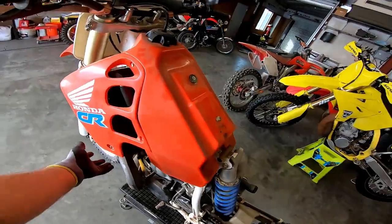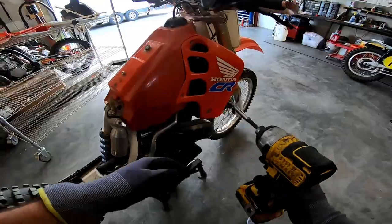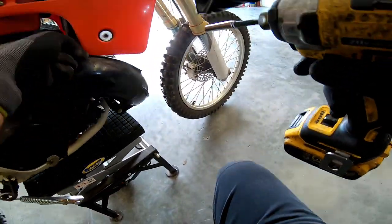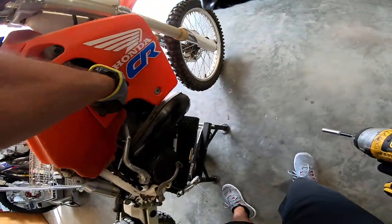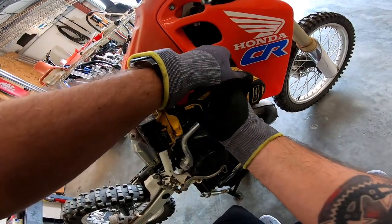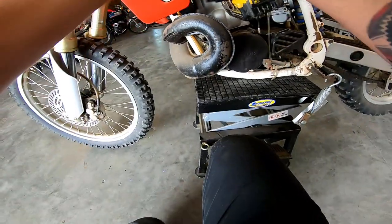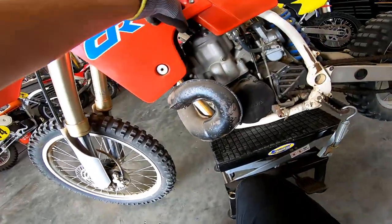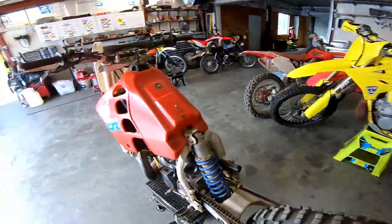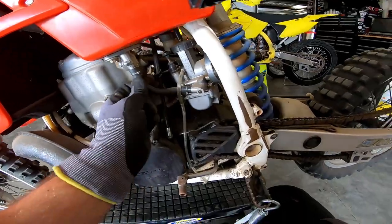Let's do the tank. We're going to need to get these shrouds loosened up. This thing is in such good shape. Get into the other side — washer again wants to stay. There's probably some bolts inside there. Yeah, 8 millimeter. Get those out. Pretty straightforward. Tank should come right off. Got this hose — actually the carburetor hose. We've got to check that. Rock solid.